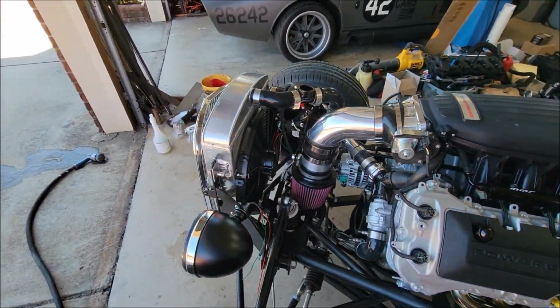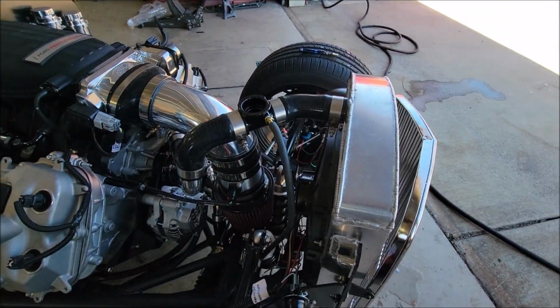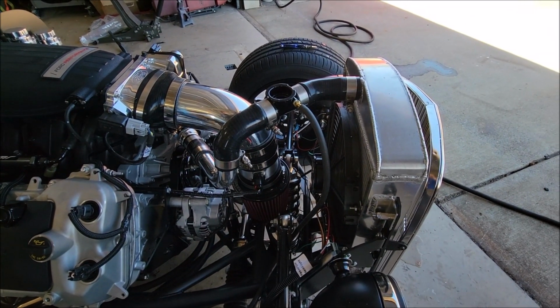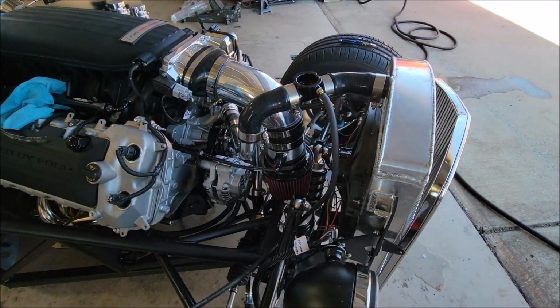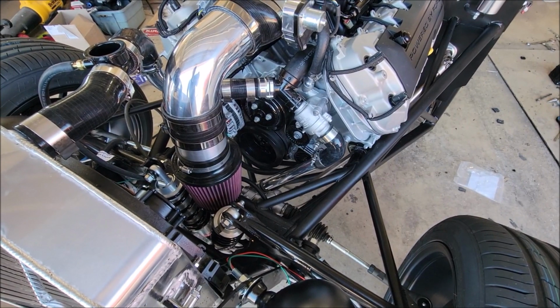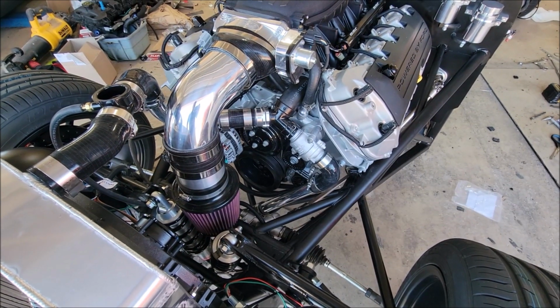I have reconfigured a little bit on the radiator assembly or the hoses, and I got my T-bolt clamps all in, so that looks fine. That's all done top and bottom, and I actually have water in the car. So the next step is to drop the tune in, and I've got the belt installed. So it's in. Now we can check charging and see how the water temp is and burp the system. I need to get the fan hooked up to see if I can control that with the ECU. So other than that, yep, we're closing in on it.